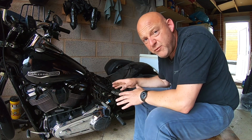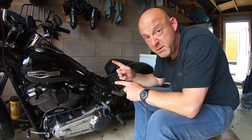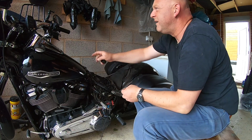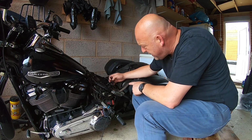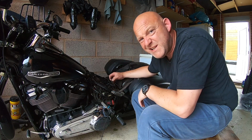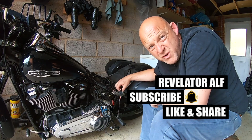What I would say is, before you start connecting this up, actually take off the main fuse of your motorcycle first of all. Isolate everything, and that's what you need to do. So that's what I'm going to do. Done. Now I've got an accessory harness right here, so that's what I'm going to wire this ezCAN to instead of going to the battery. Very simple.